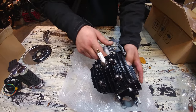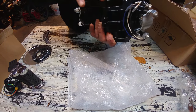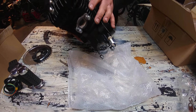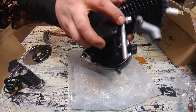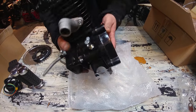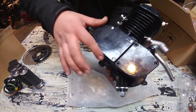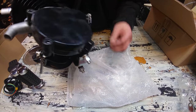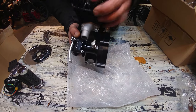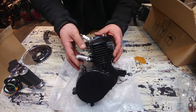It does have a 40 millimeter intake — nice chrome. The paint doesn't seem too bad; there are some scuffs from shipping that I'll hopefully touch up. 40 millimeter front mount, nice big M8 bolts, hex studs all the way around. Looks like they taped it off when they painted it. Now I do see the issue with getting them already painted — I like having all the hex bolts chrome, but these are already painted, and that's going to be a bit of a pain to get off. So it'll be time to take off the head and cylinder and see what type of rod it has in there.